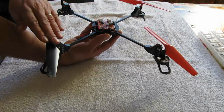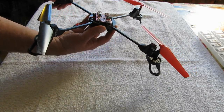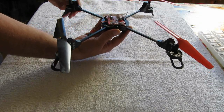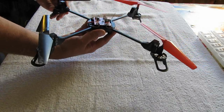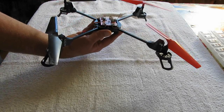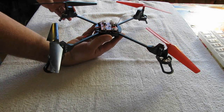In this case, my right rear motor had gone bad. While I was flying, I found that I had to get a lot of forward pitch on the quadcopter just to keep it going forward. If I let go and let the control go to center, it would start to go backward. I had a hard time landing, as you saw in the video. What you want to look for is you'll hear a lot of squealing coming from the particular motor that's going bad.